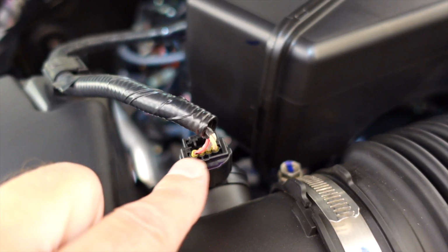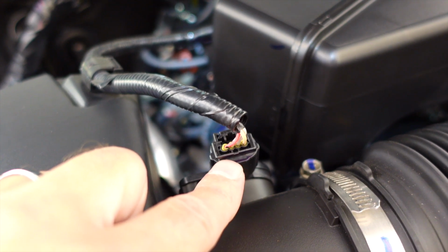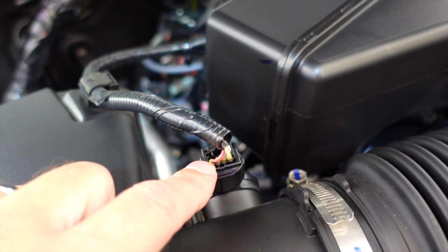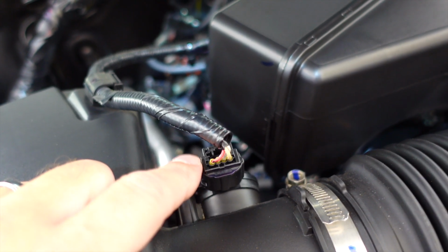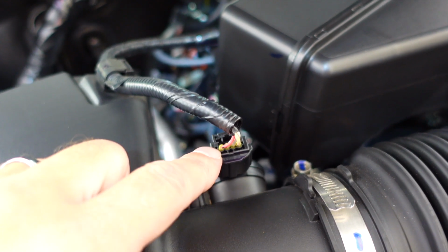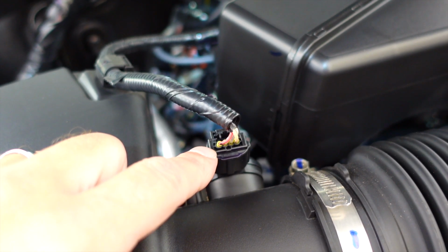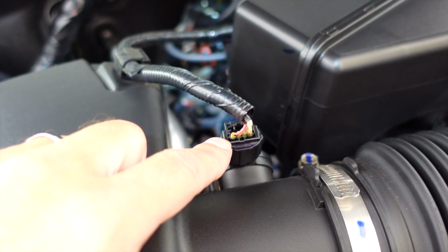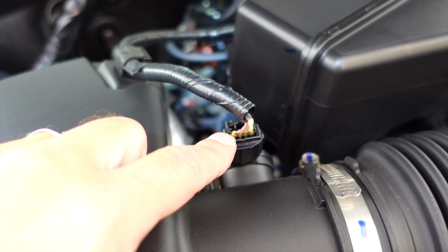It's open. There's no way that you're going to spray off the truck without having water end up down inside the MAF sensor, or at least the wiring for it. Now, if that happens and something shorts out in there, you're going to have a problem. You're going to have a nice shiny check engine light show up in your gauge cluster. There's no reason why that should ever happen. If anything, grab a rag and just start wiping. That's not a big deal.